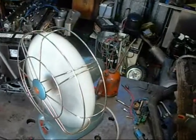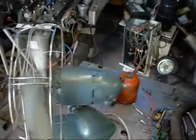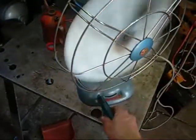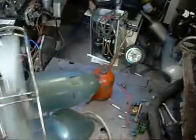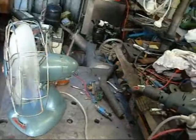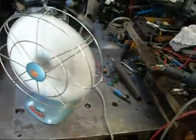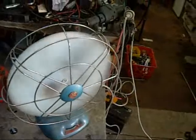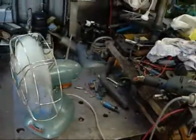But this one seems happy. I just lubed the motor — I put a drop of sliding surface oil down the motor. Give it a quick clean up and it'll make a good bedroom fan. I was thinking of giving it to Brad but he's got a whole collection already. I need a nice, clean, tidy example to keep in my bedroom as a normal fan. I'd rather wait until something like this comes along than buy one of those nasty cheap pieces of crap. At least I know this thing will still be working when I'm dead — 50, 60 years time this thing will still be going.